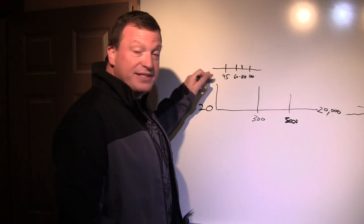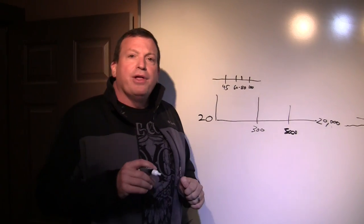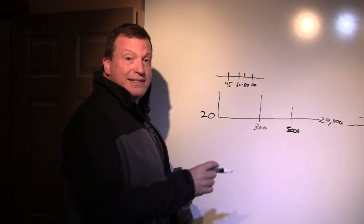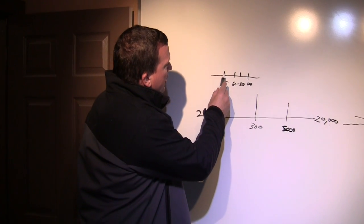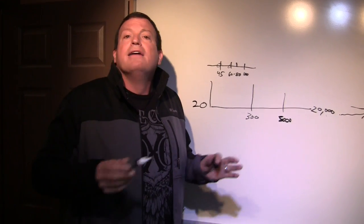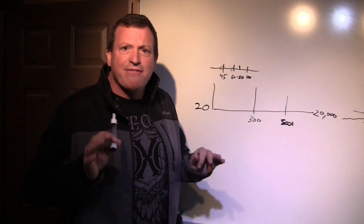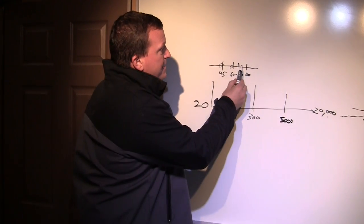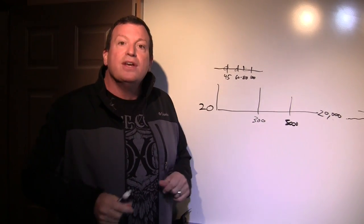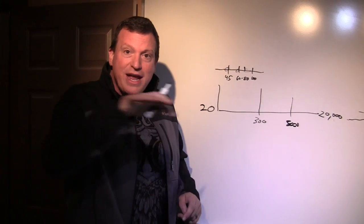Now when you put a sealed box in your car, say you're going to play Too Short or something super heavy bass, now that's going to put the emphasis right in here, right around 45 to 60 hertz. If you play Van Halen or some of that Godsmack, really heavy, tight bass, that's going to be up in the 80 to 100 area, and it needs a faster response. So with a sealed box, it plays it uniformly all the way across.